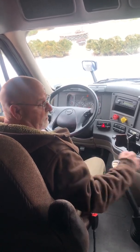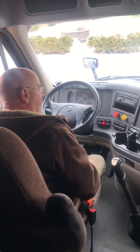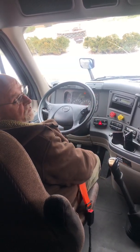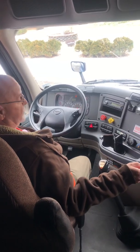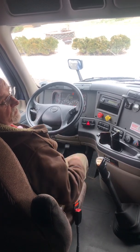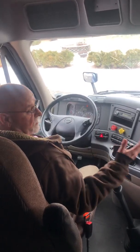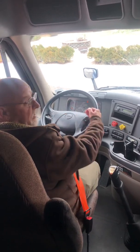Sir, ma'am, would you time me? Yes. Okay. You ask the gentleman, would you time me? He'll tell you go ahead, yes, whatever. Push the pedal to the floor and hold it. Do not release it till he says something. Otherwise, you're going to have to hold it a whole minute. If you push it down before you ask him, will you time me, you have to hold it the whole minute. So you ask him, would you time me? He'll say yes. You push it down. A few seconds later, he's going to tell you, that's fine, that's good, that's a minute, something to that effect. Then you can release the pedal. So you don't have to sit there the whole minute.